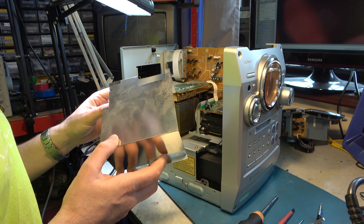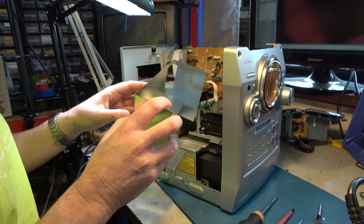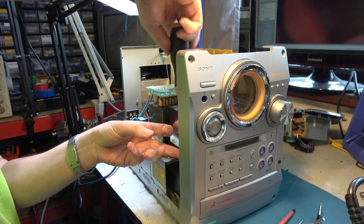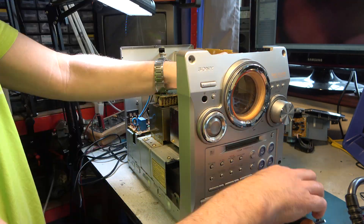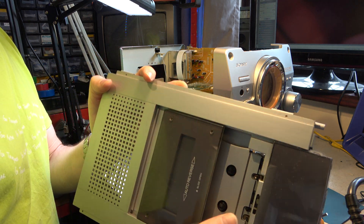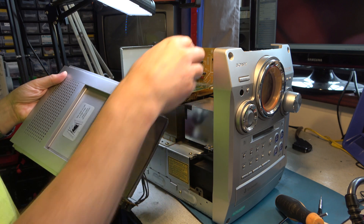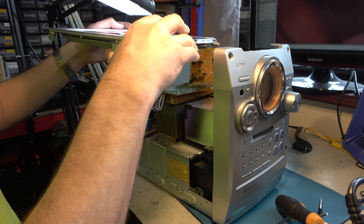This screening can is the fiddly bit, because clearly you're supposed to take the front off in order to remove this — so it's a little bit awkward, but we can do it. We're fitting the top. I see there's a switch here, and I believe that's operated by the open/close mechanism. To reduce the chances of crushing it when fitting the top, it'd be best to open the cassette door before refitting the top panel.